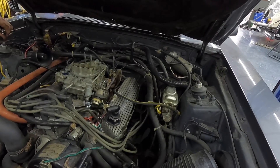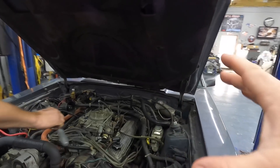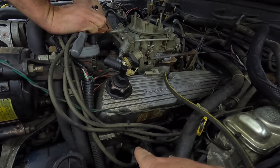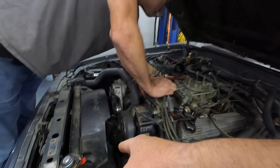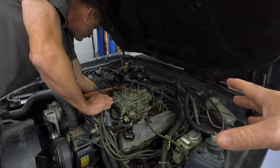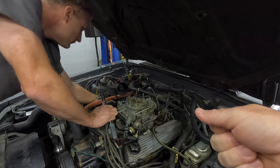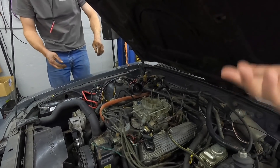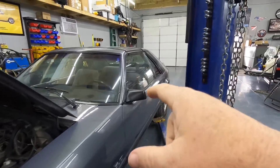As far as your engine, if you don't know anything about it, probably the best thing you can do is pull a plug out and drop a little bit of oil into each cylinder through the spark plug hole. Get some oil down in the cylinder, then turn the engine over by hand just to make sure it's not stuck or frozen up. Probably the best thing to do before you hook the battery up and fire it up is get lubrication down into the cylinders, because they're going to be dry — you can tear your rings up or score the cylinder wall if you dry-start it.